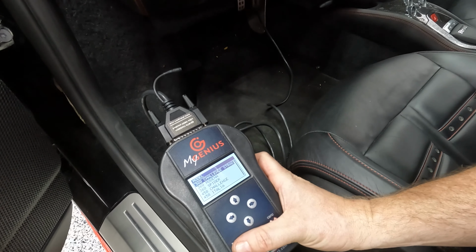Okay, while I have the 458 in the air, I'm gonna remove this little screw right here. This one is an Allen, this one as well. This is a Torx, I wanna say T27. These two connect the bumper, and then there's two more over here, because we're gonna remove the bumper eventually, so I'm just gonna preemptively pull those off before I lower the car down and start working up top.